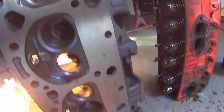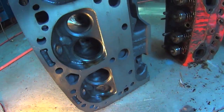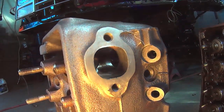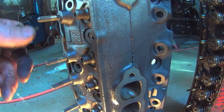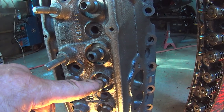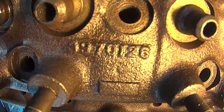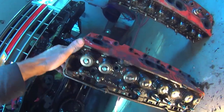I need to spend another day on these heads, get them all ready for the machinist, because I'm going in a week to Ron's, so got to have them ready. Check those seals — it should be able to fit on here. There are positive seals for the intake, umbrella seals for the exhaust, and O-rings. 397-0126. 397-0126.